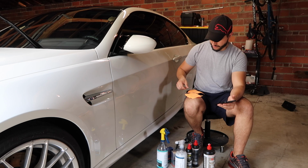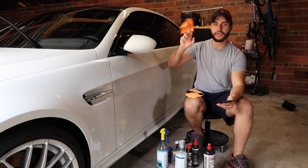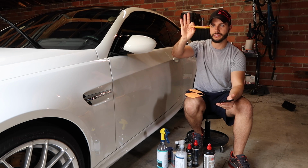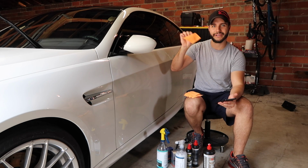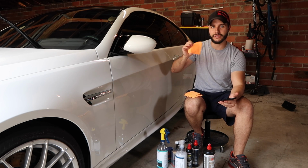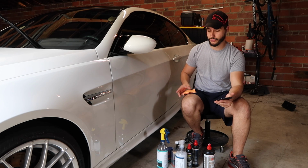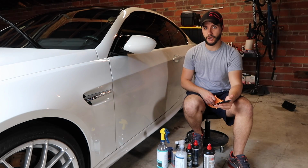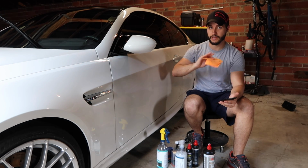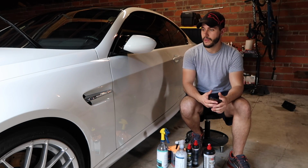And I would say make sure you mind the coating, because anything you touch with this will bond. This is normally very inflexible, but these are the ones that I used. I wanted to demonstrate, when you're buffing it, wiping off the excess, use a lint-free towel that will be disposed of. Don't use your good high pile microfibers, because those will be garbage. You don't want to wash those with anything else. You have to throw them away. You have to. So anyways, I went with Cquartz UK.